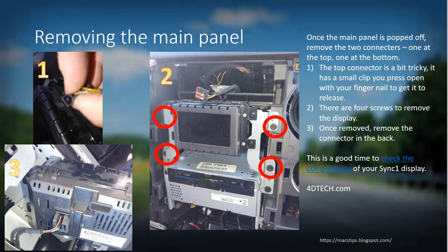After that, there are four screws to undo to remove the display from the radio mount. Once you have the display removed, this is a good time to check the serial number and model number on the 4D Tech site for compatibility. There's a video there I'll link in the description. It shows you how to ohm out the screen to make sure it has the 70-ohm video chip — measure across pins 6 and 12. They also list compatible and incompatible displays, so as long as your display measures 70 ohms or is on their compatibility list, you should be good to go.